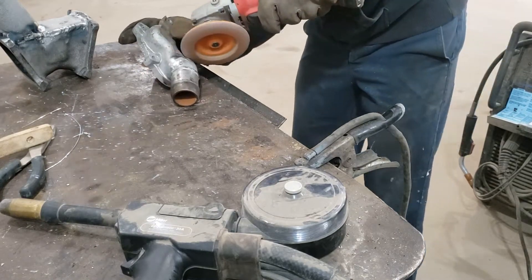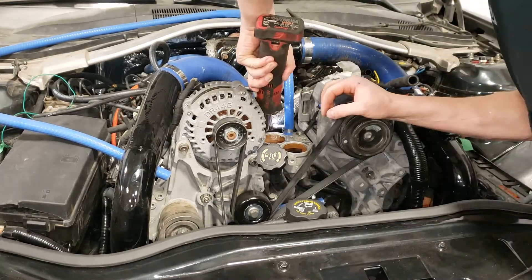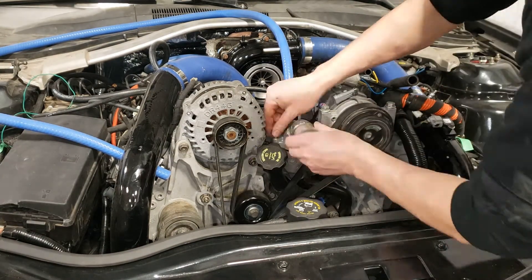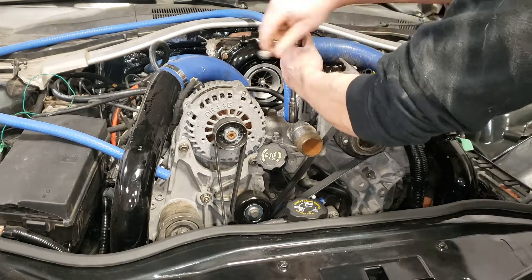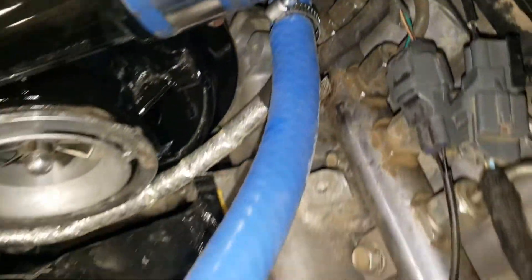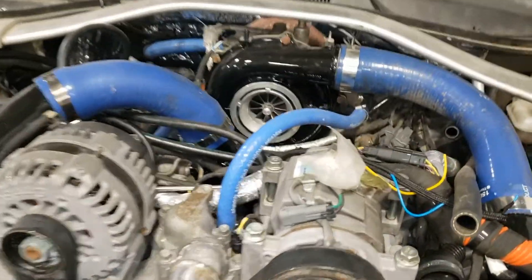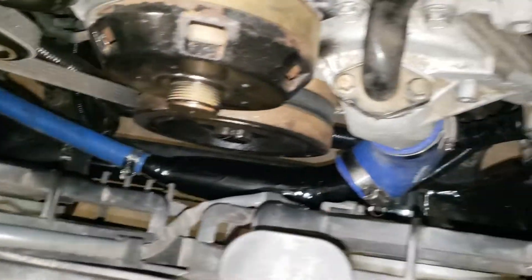With all that done I was able to put the half inch heater hose onto the line we cut down — this one's going to loop up and over and connect to the coolant port off the side of the turbo. Then I dropped a couple of new thermostats in and put on our modified factory LML housing, and got those bolts tightened down to spec. You can see the line coming off the turbo just kind of loops over and connects there. At the back you can see I used that LML EGR feed to go to one side of the heater core, and the other heater core line comes down the factory line along the frame rail and connects to the bottom pipe.